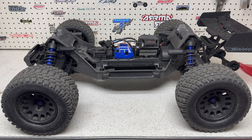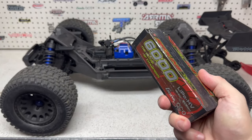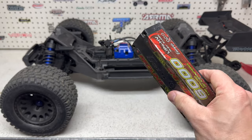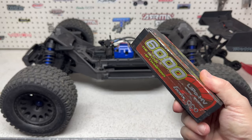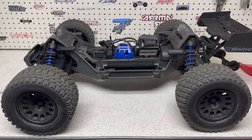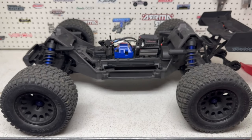First is my concern. The truck was warm. It was hot. The motor itself, guys, was pretty hot. I could barely hold my finger on it. The ESC had some warmth. But not only that, guys, my red lines, which usually don't even break a sweat, these are still warm. And it's, let's say, 5-10 minutes later, and they're still warm. So these guys themselves, which are beasts of LiPos, 130C discharge rate, were warm. Like, not hot, but warm. And again, they usually don't even get warm.